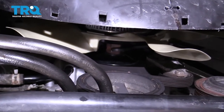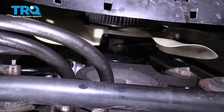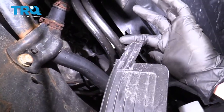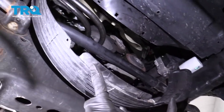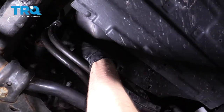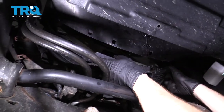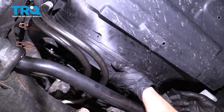When I go to snug this, I'm only going to give it a quick loving tap, essentially just to bottom it out and make sure it's snug. You don't need to ream on this because when the engine's turning, it's going to be trying to tighten this even more. Now we can start getting this shield on here. Areas to pay attention to are those hooks that go up along each side of the fan shroud, and then of course the locking tabs that need to go into that fan shroud. Let's carefully get this up and into position, slide it into the grooves along both sides. When I slide it up, I'm going to have it pressed towards the engine, bring it up as far as we can, then pull it towards the fan shroud to lock it in. Give it a little wiggle and make sure it's secure.